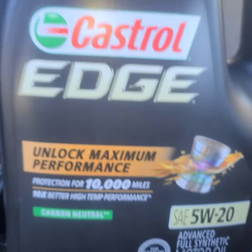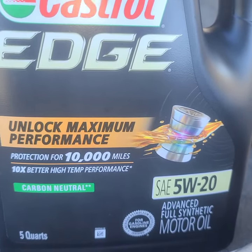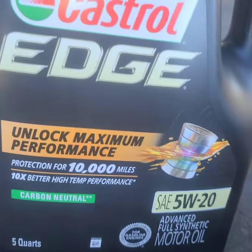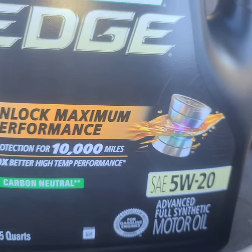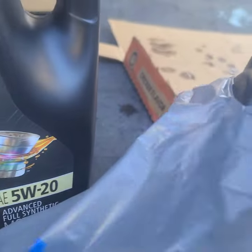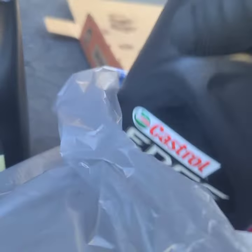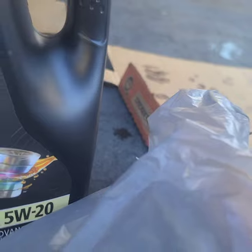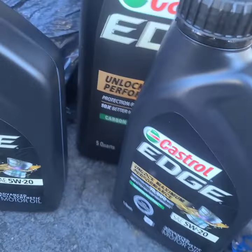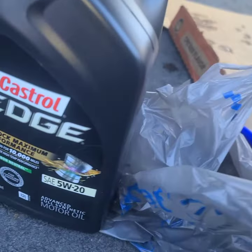Here's your oil type — I've always stuck with this brand as well. I have the Chrysler formula — it's always ran fine, never had a problem. So five quarts here, two more in there — seven quarts total. Make sure they're all the same 5W-20.